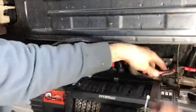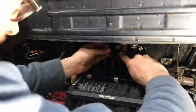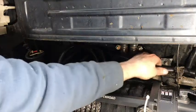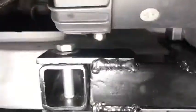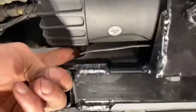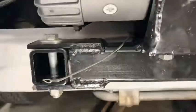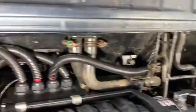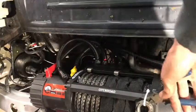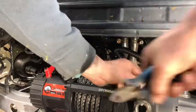The last piece of loom goes over the main supply connection that comes from a switch directly on the other side of the firewall — the main shutoff switch. The ground connection is made to the frame, comes up underneath and attaches, and a skinny little wire also goes to the ground terminal — it comes from the electrical box where the receiver and relays are. That power supply runs into the firewall to the switch and then out back to the battery where the power comes from.